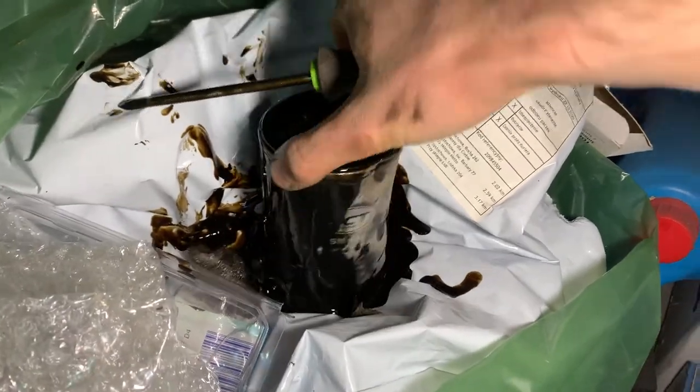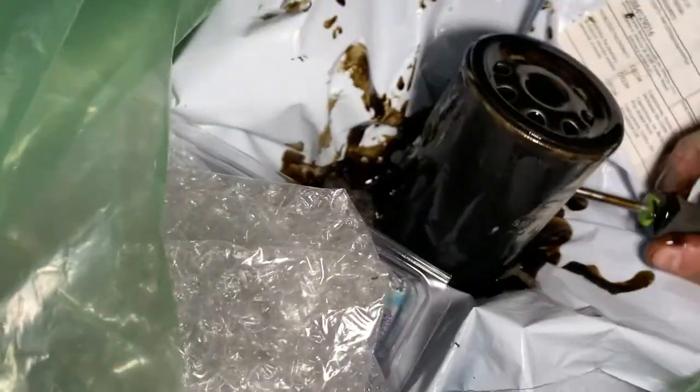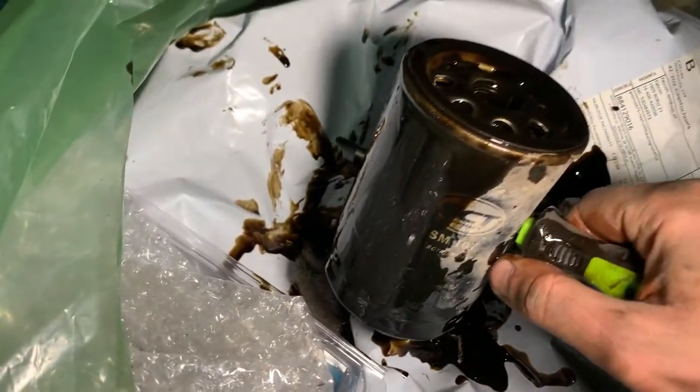This is my trash and this is my filter. What I did is I put a screwdriver right here and hammered it to push it through to the other side, just like that. Now that it's on both sides, you can start pulling it in order to unscrew the filter. If you try to hammer it only through one wall, it's going to break and it's not going to unbolt. When it's through both walls, it's easy to unbolt. Don't tighten your oil filter that much — it doesn't need to be that hard to remove. But it's now unbolted. So what I have to do is put the new oil filter on the engine, make sure the drain plug is fully bolted, and fill the engine with new oil. Finally. I made so much mess.